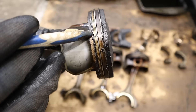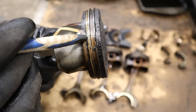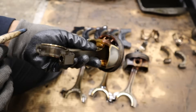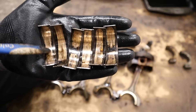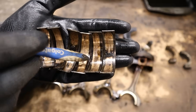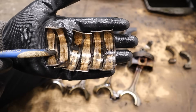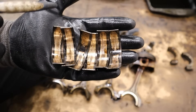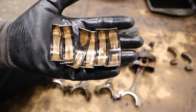Looking at the oil rings here, you can see they're pretty much clogged up. This is a modern engine that uses low-tension oil rings, which are very small and don't allow too much oil to return back down, causing the engine to burn oil. Typical Kia and Hyundai owners don't check their oil, and when you run these low in oil, it damages the bottom end. The connecting rod bearings are absolutely roasted — they've worn through the coating and gone straight to the copper surface underneath. A couple even have burn marks. This is likely the reason the engine didn't turn over — eight of these bearings are essentially seizing up against the crankshaft, all due to lack of lubrication. I'm actually surprised none of these connecting rods spun around; the engine just chose to seize up rather than develop a knock with a completely missing bearing.